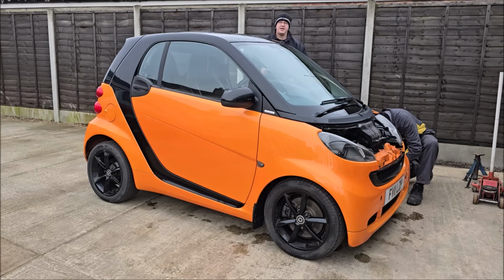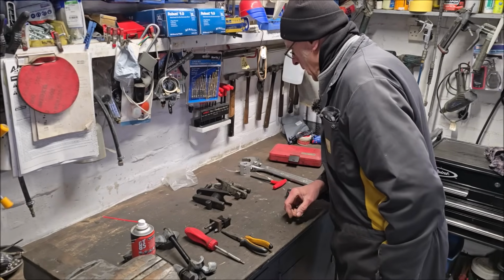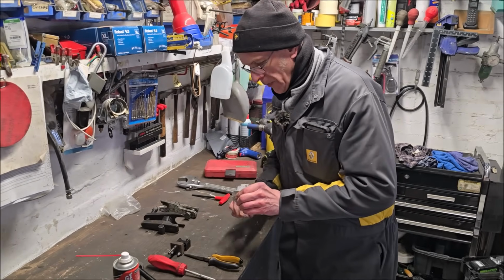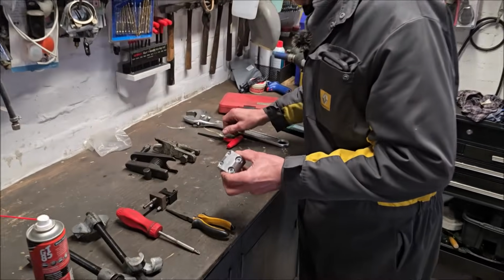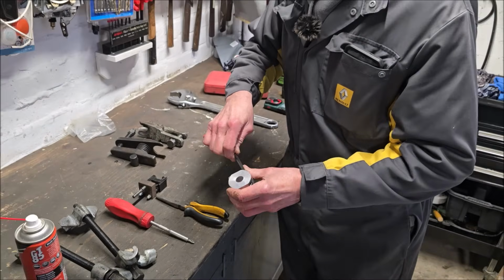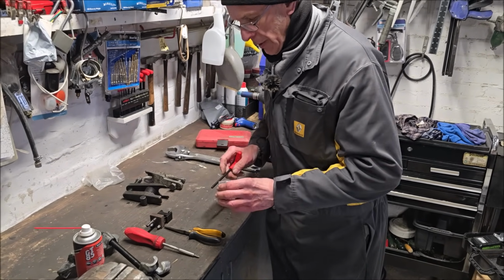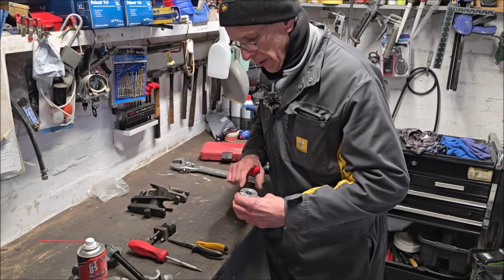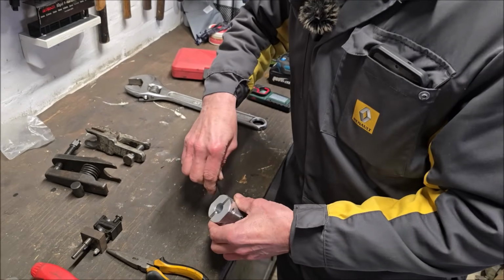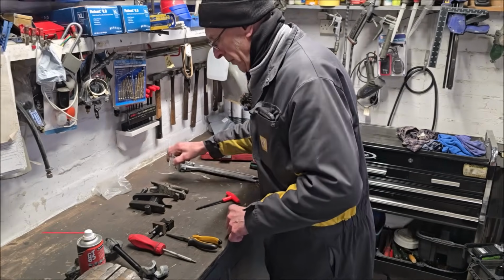So we're going to do the near side first. Locking wheel nut tool. Make sure you know where yours is. So you're gearing up with your tools to do the job. There's some specialist tools that Kane has sent us to do this, like we spoke about. So what is that there? Hopefully that should clamp round the shock absorber rod without damaging it. Then we can put a big spanner on it and hold it to undo the top. So you put the spanner through the spring. Hopefully, yeah. We'll see how it goes. And then we can stop it from turning. Because last time, when we did this, everything was turning around, wasn't it?